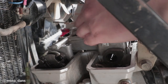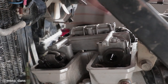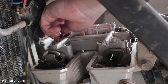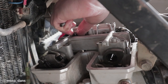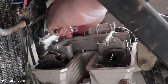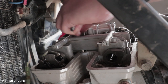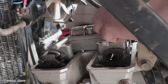Now the benefit of doing this mod, the ACR mod, as well as making it much easier to kickstart, is you're putting a lot less stress on the idler gear - that apparently in these can blow up quite commonly, so this pretty much alleviates that issue. 2002 onward bikes were factory fixed for this, so if you just bought an exhaust cam off a 2002 onward bike it would already have this mod done to it.